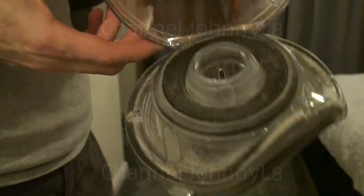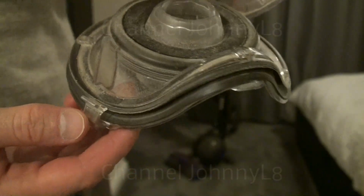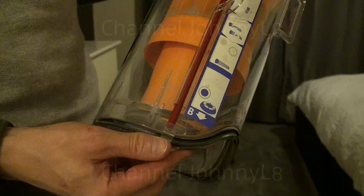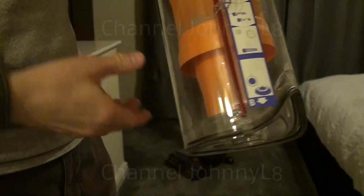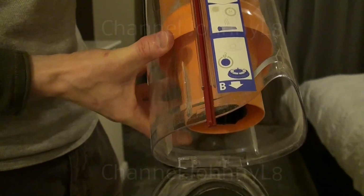I've also seen some people who clean the bin with wipes or water every time they empty it for some reason, then struggle to open the trapdoor easily next time. If it's been washed, the rubber can become sticky, and it's supposed to have dust on it or powder from the factory to help it slip. So the trick is to keep the rubber seal dusty so it slides properly when you open it and doesn't get jammed.